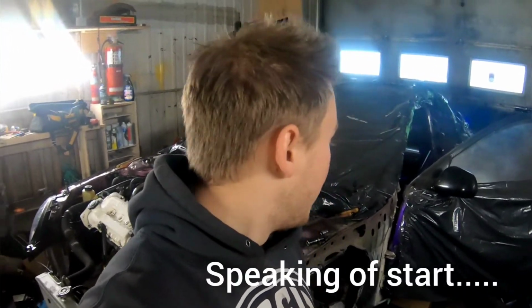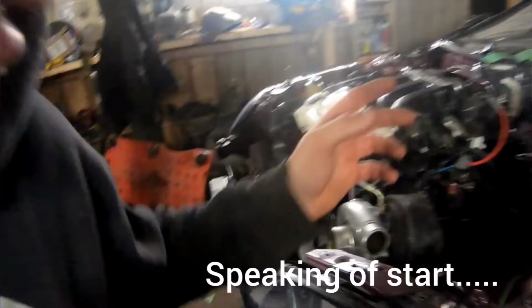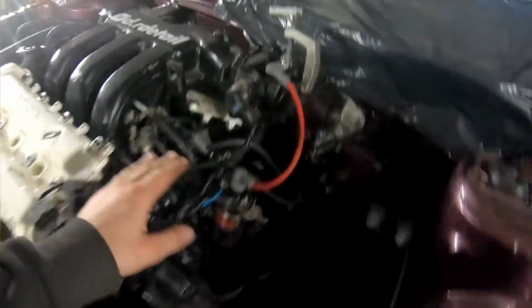I apologize, I didn't tell you before that you have to make sure that your fuel pump is not getting power while you're cranking it over with the plugs out, because you don't want fuel going everywhere. So I'm completely putting new fuel in, cleaned out my entire fuel system, got a nice fresh start. So now, before I'm even putting my distributor together, I'm gonna make sure I've got spark.